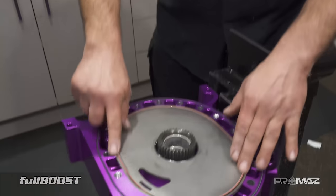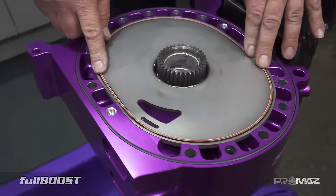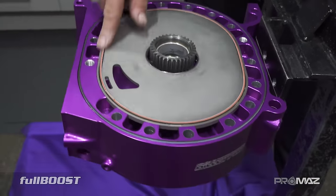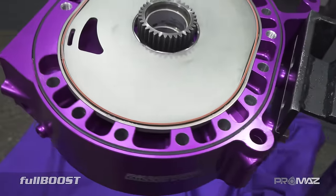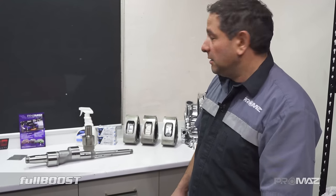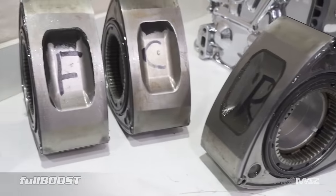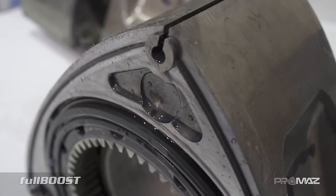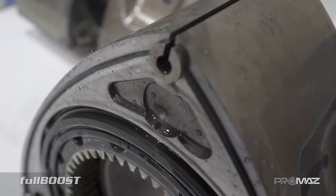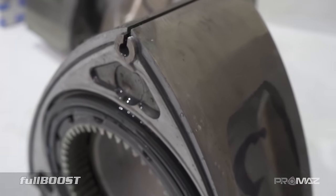The inlet port is the coolest spot. Vaseline is petroleum-based, so it's really no good for the O-rings — that's a big no-no. I've actually used silicone grease on the rotors today instead of Vaseline, just so you can see the side seal more clearly. We spend probably a good two days prepping this engine before the assembly process.